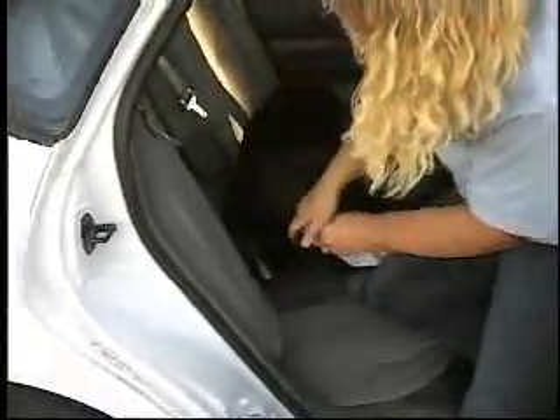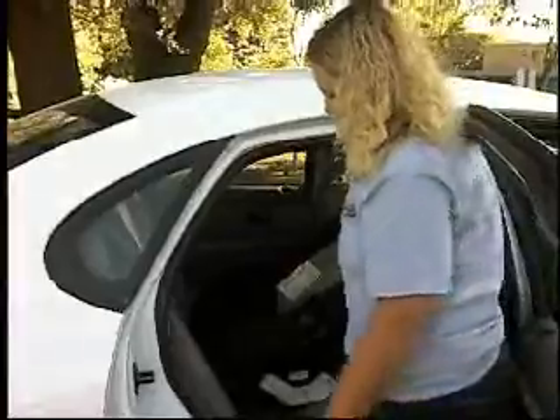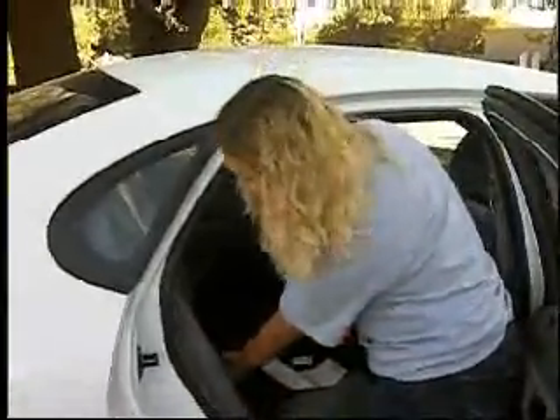You take your anchor and you just buckle it in and pull it tight. We've anchored this side. Now we come over to this side of the seat and pull it tight like a seat belt. Sometimes you have to put your hand under here and grab the other side and pull it tighter, because you don't want it to move more than an inch from side to side. You'll always have movement up here on a rear facing infant seat, which is what you want, so you always check for tightness at your belt path.